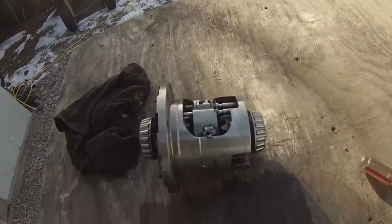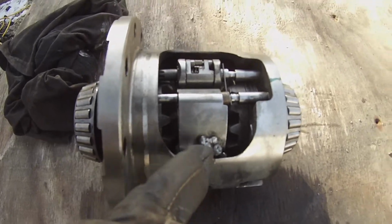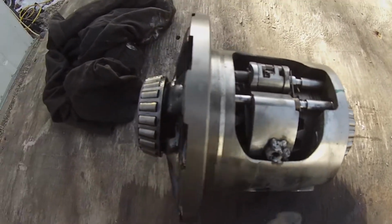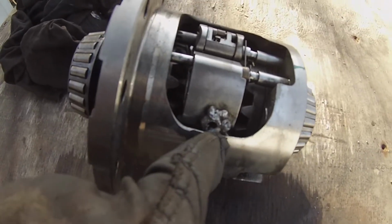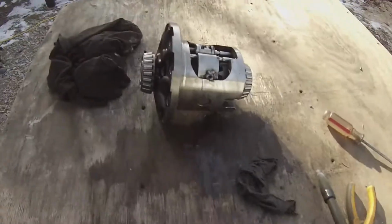Alright, so I got it welded. I don't know what happened. I think I could have cleaned the metal better. There was some oil in it, so it came out. I got a little porosity on some of them, but there it's good and there it's good, and there's even a little bit there that I just put in for extra measure, so that's pretty good.